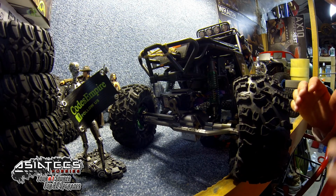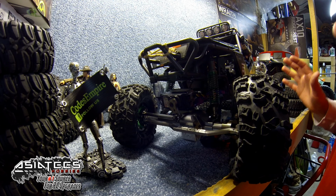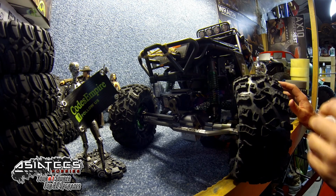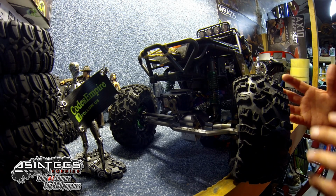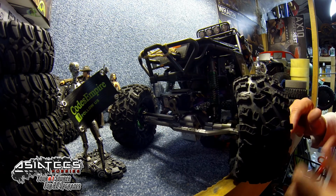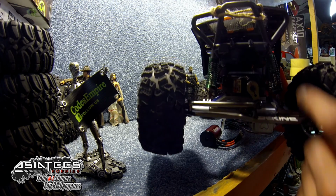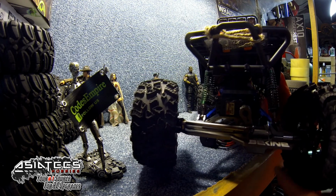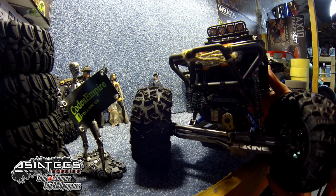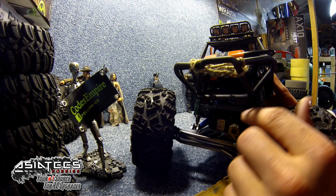That's right, my friends. You've just gotten to see the beast in action. He's not totally put back together, but he's sure looking awesome, and the things we've done to him. Some of the things that you didn't see on the video, well, we were sitting there testing out this new brushless system. For instance, we've since upgraded and put a bigger high-tech servo on, and you can see which one that is. This bad boy with our 10 amp BEC installed and everything, and I've waterproofed this with our silicone conformal coating, which you got to see kind of tossed in the mix.